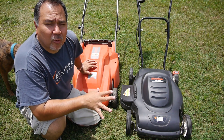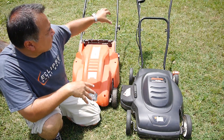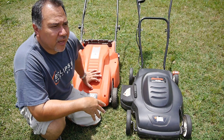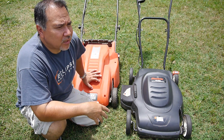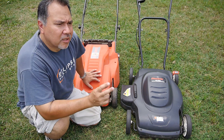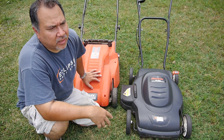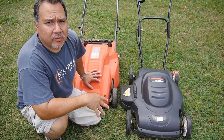They're not fail-safe. There are a few things that can go wrong with an electric mower. You have a switch that can go bad, of course the electric motor itself could go bad, the brushes on the motor need to be replaced every once in a while, and there's also a bridge rectifier mounted on the mower that it's very common for to go out. Others have an added capacitor. So there are a few points there — they don't last forever.